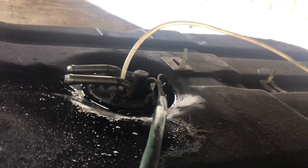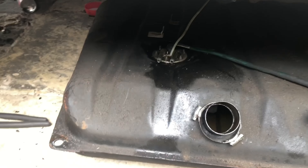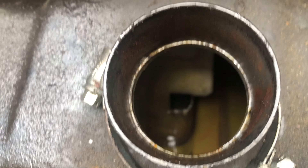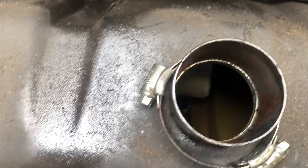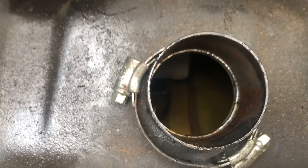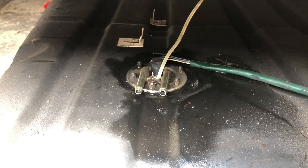The sender unit is there and I think I know exactly what the problem is. There was quite a bit of diesel in really — it was surprising to see the fuel light had come on solid. I'll just attempt to show you — probably about an inch of diesel remaining, quite a bit of weight in the tank. We'll just remove these bolts from the sender unit.